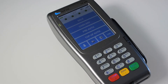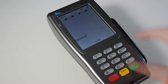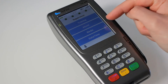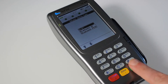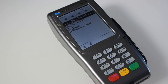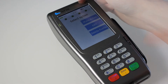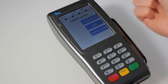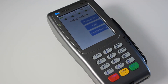If you do get any errors, go back into Supervisor and then go into Media or Wi-Fi, whichever one your terminal has. Select Wi-Fi, and on the Wi-Fi profile screen, go down to your Wi-Fi with the arrows on screen and press enter. Check the red line isn't there first, then select Make Active to try and connect it. If it doesn't work, delete the profile and start the Wi-Fi setup process again.